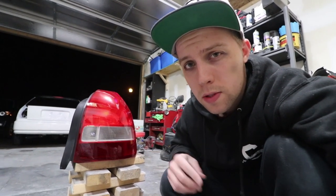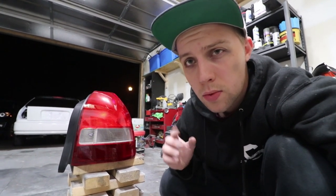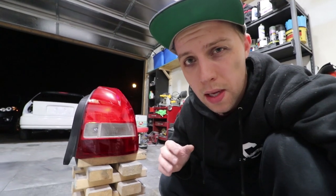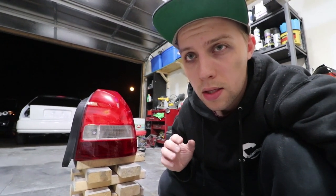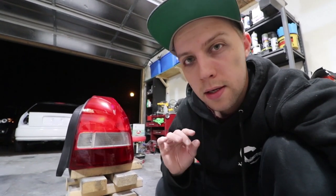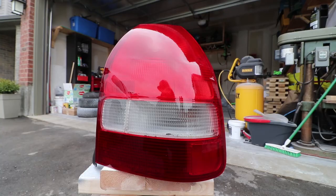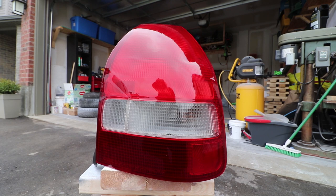The tail lights got about five coats of clear — we went heavy on that because I want to really polish these down nicely. We're going to start with some 1500 and 2000 grit sandpaper to block that down nicely and get them nice and smooth, because with more coats a little more orange peel came out. There is some orange peel to the clear coat I laid yesterday — about five layers of clear will show a little bit of orange peel. Step one: knock it down with 1500 grit sandpaper, basically making it just look dull.